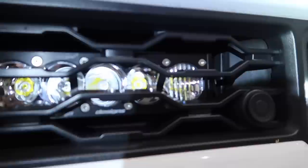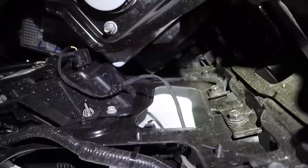The light bar is installed — I wouldn't tighten the nuts up too much so you can still adjust it. There isn't much adjustment — about a finger's width of play — so I'm setting it as straight as possible. We'll go for a drive at night and try it out. For the wiring, I'm going to run this wire down and follow the existing factory wiring harness right there, then take it up top to connect it to the auxiliary.